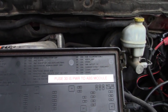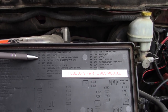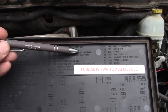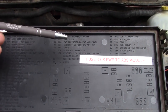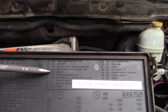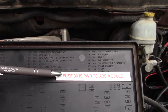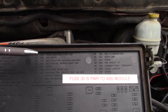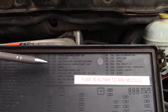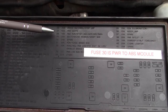All that for a missing fuse. I wanted to add this part of the video because it's important to understand what's going on. Fuse 28 is in fact labeled as ABS power, but what we found was that spare fuse 30 is what actually sends power to the ABS module. I've labeled that for future use so there's no more confusion. Sure made a lot of work on my part, but we have partial ABS module power back.